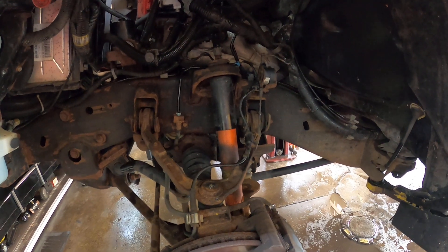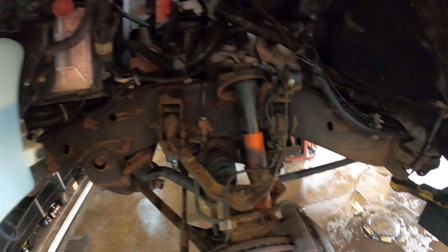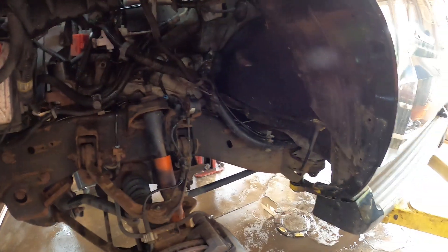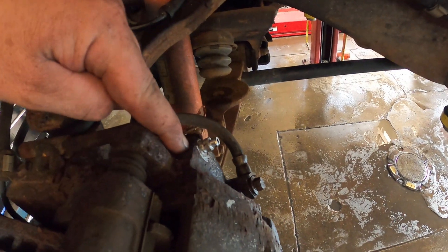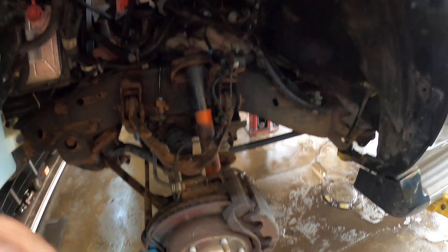Part of the problem is the right front line runs all the way from that computer, all the way up here, then across the cross member, and then over to the right front wheel — so it's a very difficult job. It took me about four hours yesterday and five hours today, and then I had to extract the bleeders, so be prepared to put calipers on if you can't get the bleeders out. You are going to need a scanner to bleed the brakes.